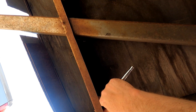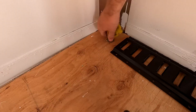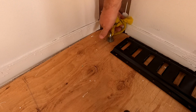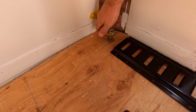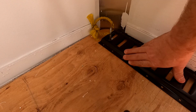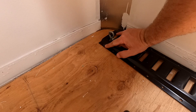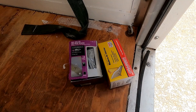Let's crawl underneath the trailer — it's a 13 millimeter bolt, actually kind of loose, which is maybe good since I'm taking it apart. Not rusted shut either, so that's advantageous. That came off remarkably easy — almost concerningly easy. Turns out it's also screwed in, which makes sense. I'm going to put it right back down through the e-track, fill the hole, and since the hole goes through the frame of the trailer I know those two screws will be lined up when I put the self-tapper down through — so that's a bonus.